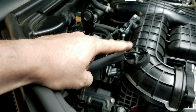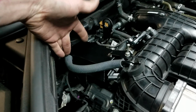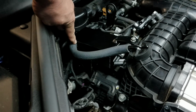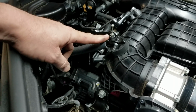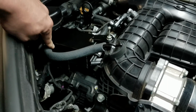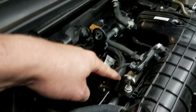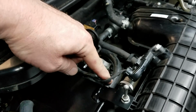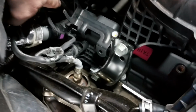So here's how this side works. Vacuum from your intake manifold pulls down into the catch can. I have an integrated check valve down here to keep any boost from getting blown past the PCV valve. So it's when this goes into boost, it pushes boost into the catch can. Comes across. Over on the back side over here, this is your line that goes out, wraps around, goes down under, and connects. Probably can't see that, but there's a hose right there.